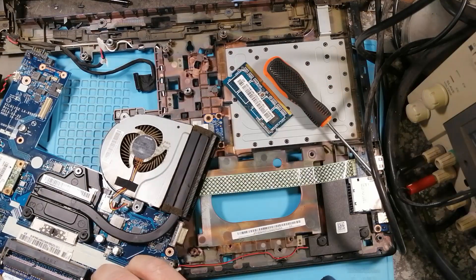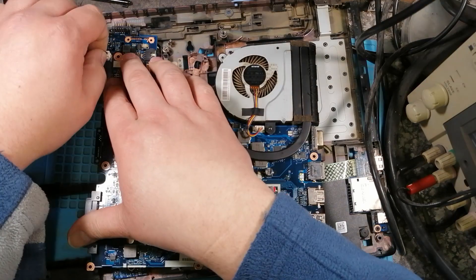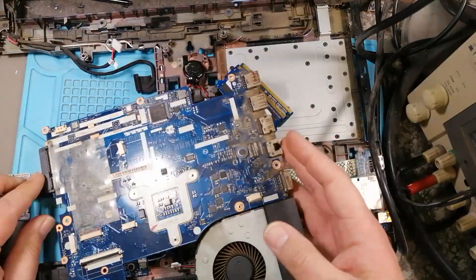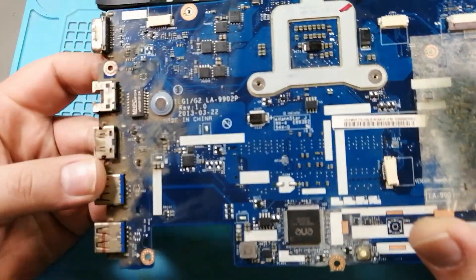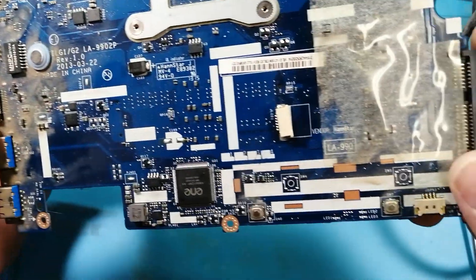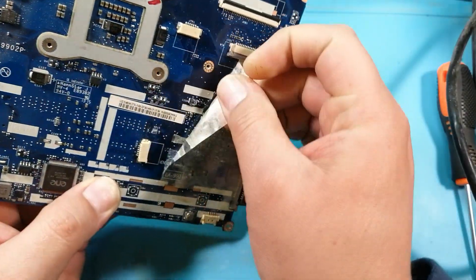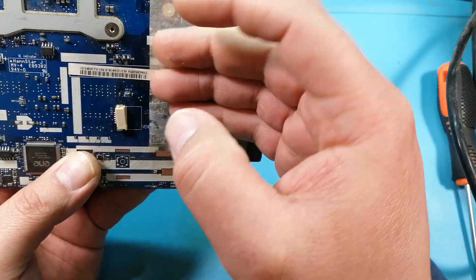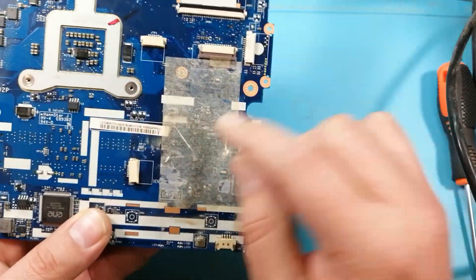Let's check out the RAM as well. Let me reposition the camera so we can have a look over the board and see if we can see any damage. Unplug the CMOS battery as well — so the board is completely dead, no power. It's quite dirty here and it looks like we've got some liquid damage over here. The board actually doesn't look that bad. Remember to take off these stickers and check under them for any liquid as well — you'd be surprised how many times I've actually found liquid under the stickers. Nothing on the top, just under the stickers.